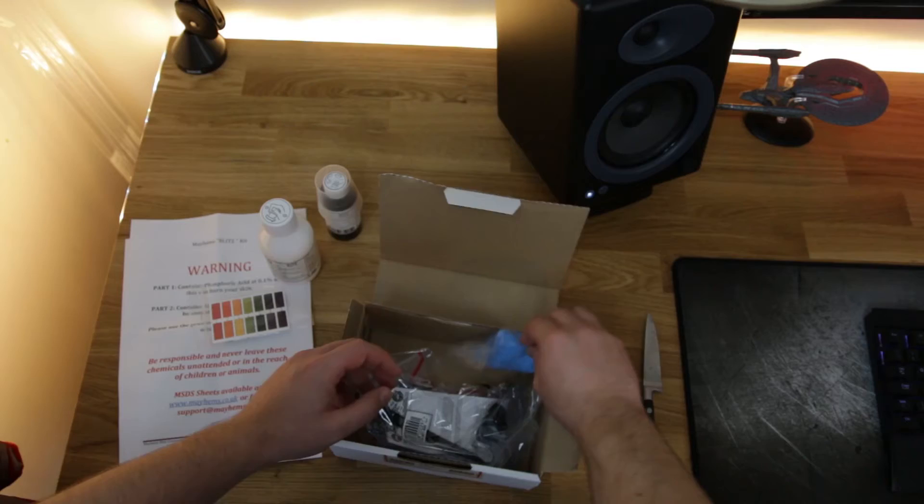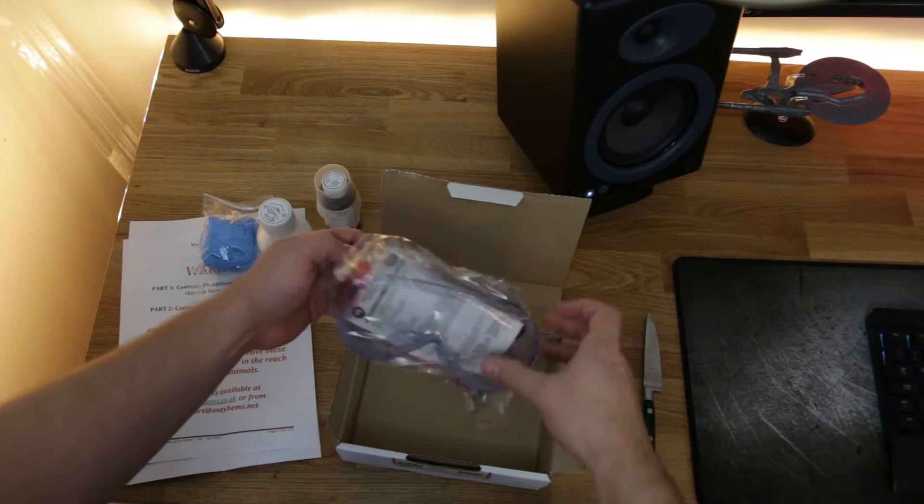The amount of time it tells you to leave it in there for feels materially over-egged if I'm honest with you. Part 2, which is the bit that you do use through the whole loop, says 12 to 24 hours. I've never been one to subscribe to the 24-hour leak test if I'm honest with you guys - a couple of hours should be more than sufficient. I'm not going to subscribe to 24 hours of cleaning the system through. These are pretty full-on chemicals, they're going to give a bloody good clean after a couple of hours. I've had this loop going for nearly a year anyway, so it was right to give it a deep clean. I think a couple of hours per cycle will be sufficient, but you be the judge guys.